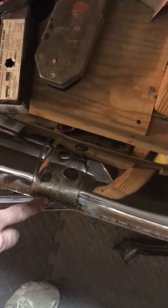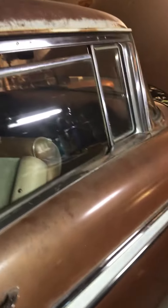Then I'll finish the backside and coat it. I'll use shark hide, which is a special chrome coating — like a clear coat you can put over chrome. You can get it from Eastwood and a couple other companies, and it works really well. Here's the front bumper — you can see it still has some rust and pitting in front, but there's that beautiful oil rub bronze on the bolts and the whole underside. I reshot and coated everything, so the whole backside is completely redone and looks really good.